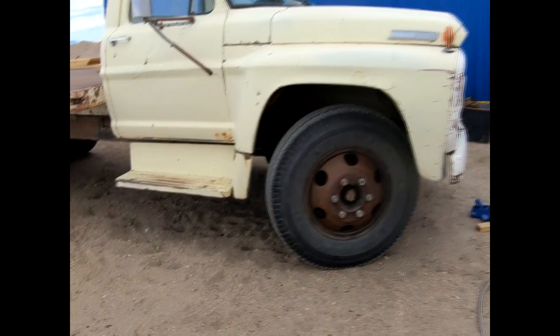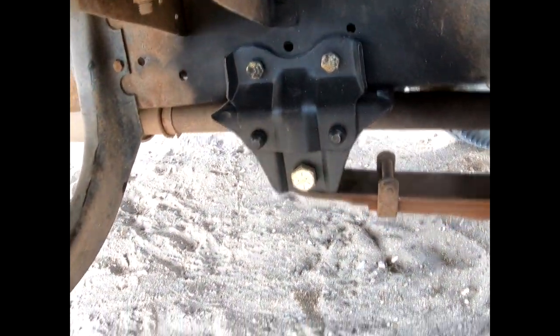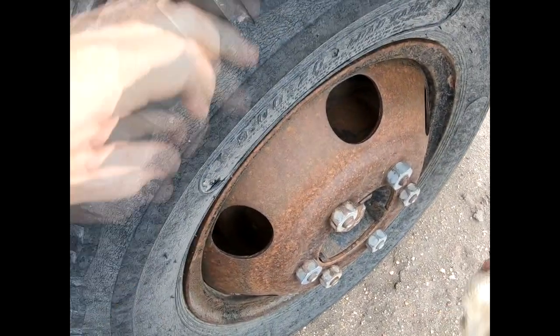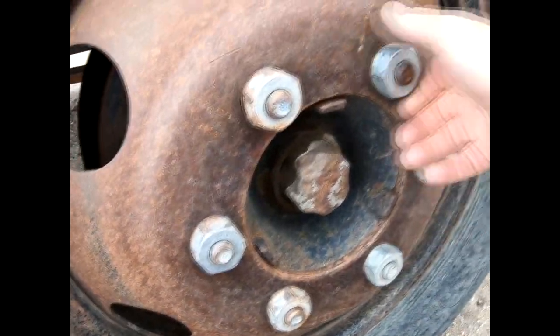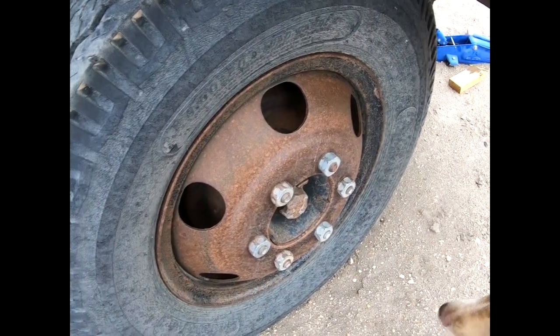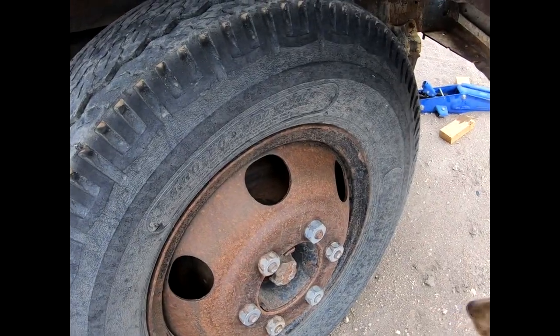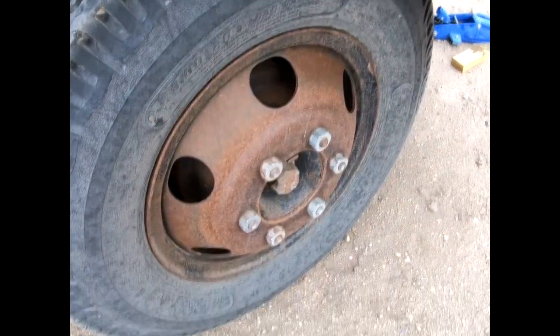Dumpy's feeling a little spring, that's good — we've got those spring hangers replaced. You may remember when we were looking at that, we spun that wheel and discovered it's making a noise. So while we've got a little more time before I have to take it up the mountain, I'm going to pull this wheel off, pull the drum off, take a look at the brake behind, and check out the bearings — they probably need repacking because this thing is so old.